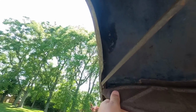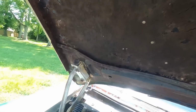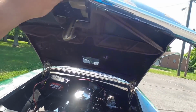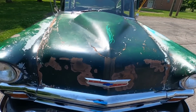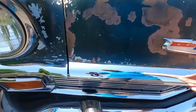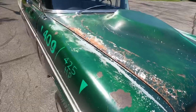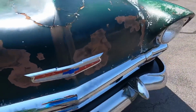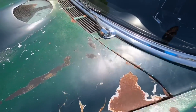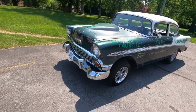Like a new latch. This little brace here needs to be replaced. A little bit of slack there. It's still got 2 safeties, but I think that it needs to be adjusted out to where it holds it tighter. I didn't notice it lifting up during the test drive. Get going fast enough, it should. We hear a little bit of a pulley noise too.